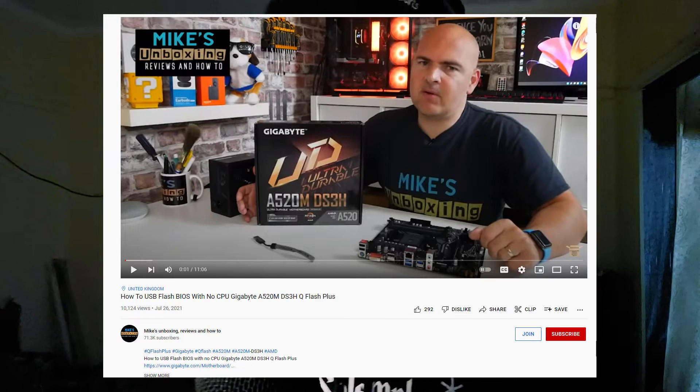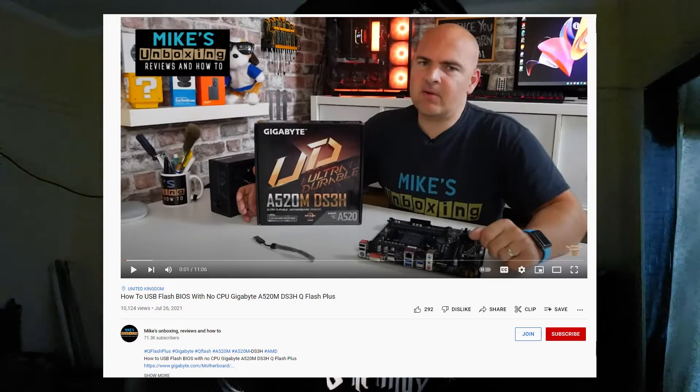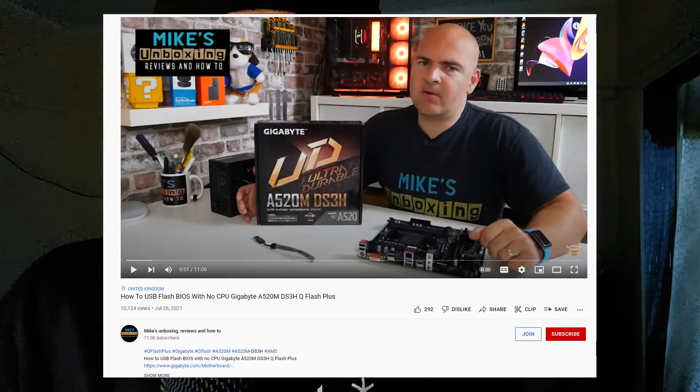It's not that easy to be honest, but it's manageable if you know what you're doing. If you're wondering why these two boards and not others — other boards are compatible with the 5600G, but they require a BIOS update using an old CPU: you power on your system with that old CPU, update the BIOS, and then install the 5600G. These two boards don't require that.